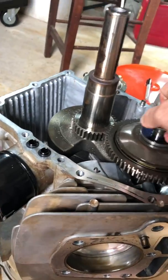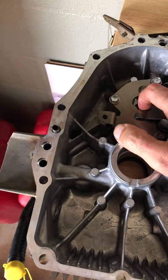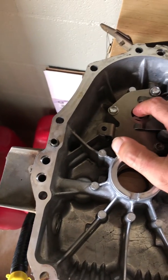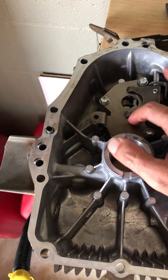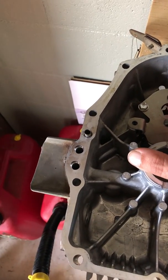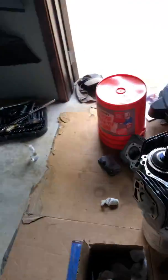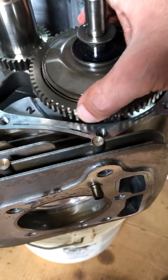Let's look at the bottom of the crankcase. Underneath here is your oil pump — it's basically two planetary gears that spin in a circular motion to pump the oil. Right here there's an oil filter screen that's used to catch the large chunks before they hit your filter. So the goal is to catch the big chunks of metal before they hit your oil filter, and then the small chunks are going to get caught by the oil filter. This oil filter is made for small particulates — inside, you're trying to catch all the dust, junk, and metal.